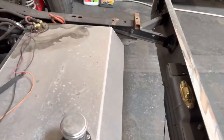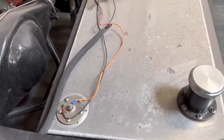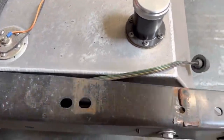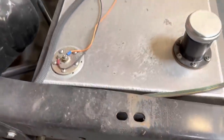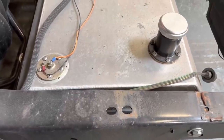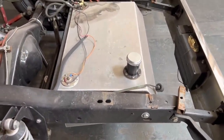The upside or the cheat for getting to those, if you can't get your hand inside the frame, which is really difficult to do, I do it all the time. I just use a magnet or a long socket or a long wrench with some tape and slide it inside the frame, and then just hold the bolt right there. But once again, these are stainless carriage bolts, so you can't tighten them from the top. So I may be swapping just those two out for maybe some Torx head, similar to what you see in a GM truck or a Ford truck.